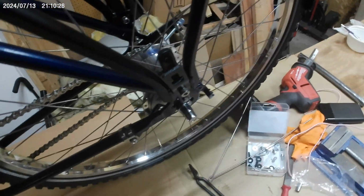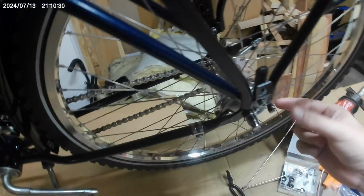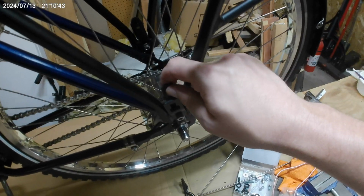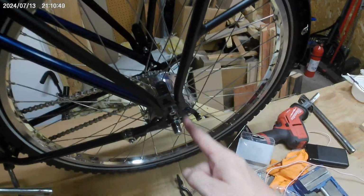We'll just pack some grease in there so it has less opportunity to rust. Plus, it'll be clamped down either side, so it shouldn't be getting water in there. And it's a big, thick piece of metal, one of the only ones on this bike. And then I'm going to flip this bracket around so that all of the holes are between here and here, and that should give me a little bit more freedom to move this thing up and down.